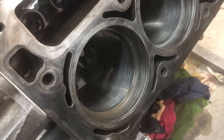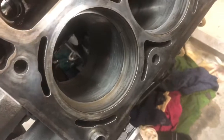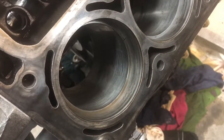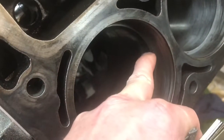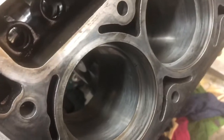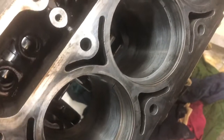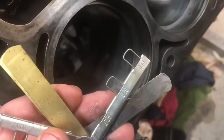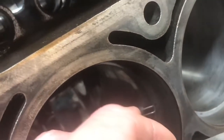So it's not new by any means. This is one of my old rings I pulled out of that piston there, and I just stuck it back in. Now I'm shooting for 22 thou, cause as the ring expands, that gap's going to get smaller. If it butts up against itself, it could crack the whole top of your piston off. So I stuck in the old ring and I've got my feeler gauges here — you can see the one on the end, 34 thou, and it fit in there.